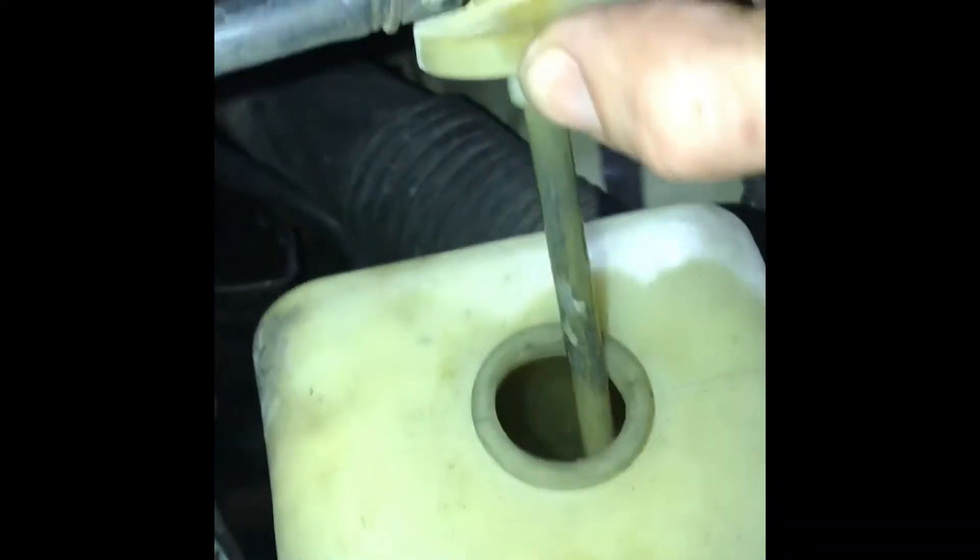So it's gonna go with a new head gasket, copper coat it, and run washers under all the head bolts and torque them all down quite a bit. Also inspect the block and whatnot while that is out — those are about the only special tricks I'm going to do. So now I'll get to replacement.